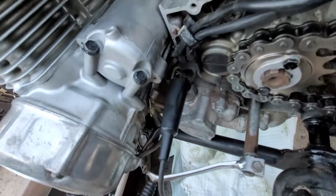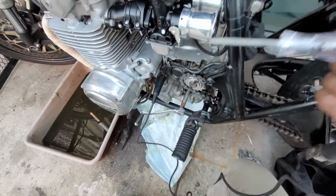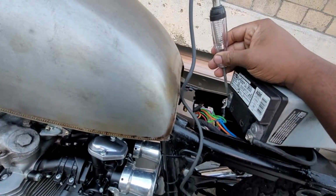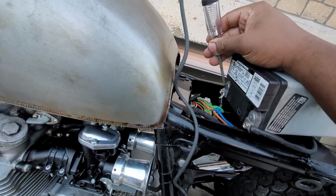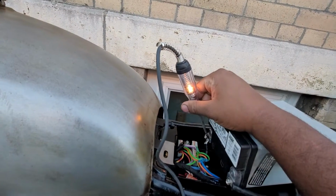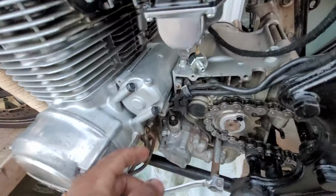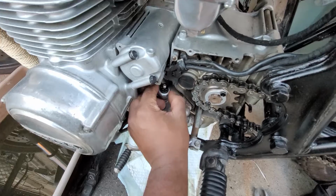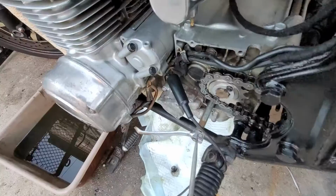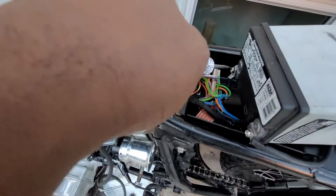Now, one thing that I noticed was the fact that the oil pressure light didn't seem to work when I tested it a while back. Obviously, we had pressure because the engine didn't seize up. With no pressure at all, the switch should be ground in the light, and since the rest of the pump body is grounded, I know the switch is busted. Luckily, I have two spares, so I just picked the better looking one. And boom, it's grounded with no pressure as it should be.